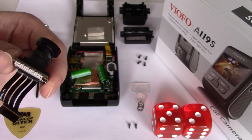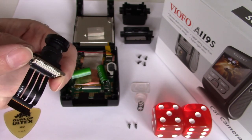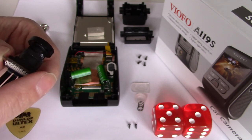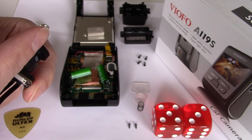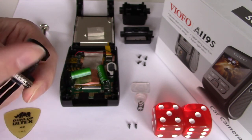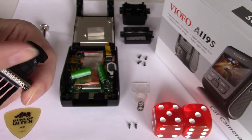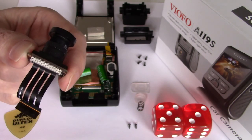So what we need to do, if you have a left side blurry image, is shift this housing to the right. That moves the entire housing — just a minor, minor adjustment — over enough that it will now grab the image on the sensor in the right area and reduce the blurriness on that side.